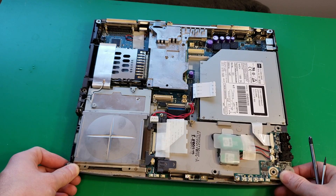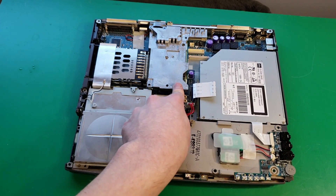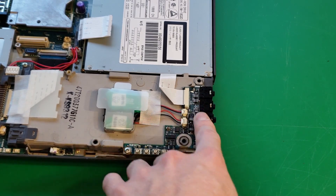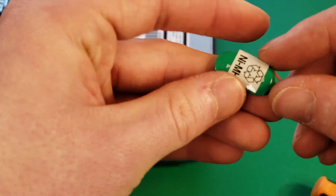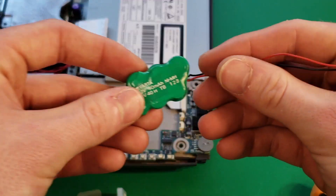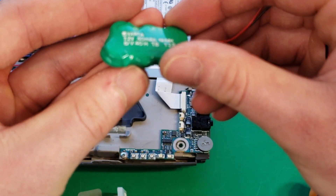I'm going to put the screen aside and take it apart near the end of the video. Here's what the rest of the laptop looks like — we have our disk drive and the CPU assembly. In the corner is a little circuit board with our LED light indicators and headphone and microphone ports. Strangely, we have two backup batteries: one small one with two button cells, and a second six-cell battery at 7.2 volts, 40 milliamp hour, also made of button cells.